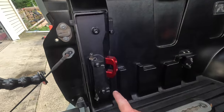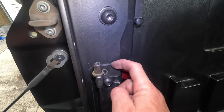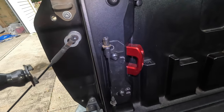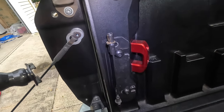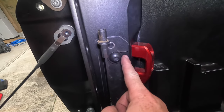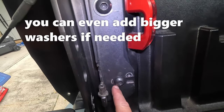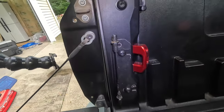So here you can see the pencil marks. This isn't tightened down all the way. Now that we have the swing case out of the way, we can get the swing case bracket lined up with our pencil marks — hopefully you can see them in there as well. Tighten everything down as far as the three Rago Fabrication bolts, so that bracket will be right where we need it. You can see we have all three bolts tightened down. The edge of the swing case bracket lines up perfectly with our pencil mark. These notches I made — you can see why that's not such a big deal because the washers for the bolts more than cover from side to side. So that bracket isn't going anywhere.